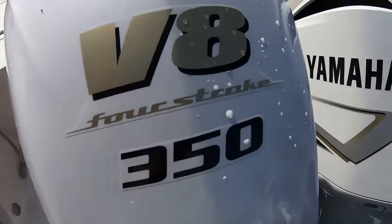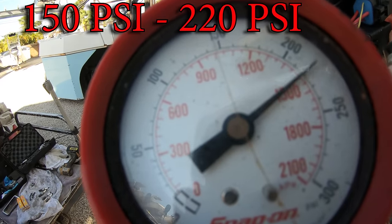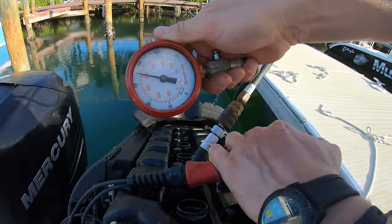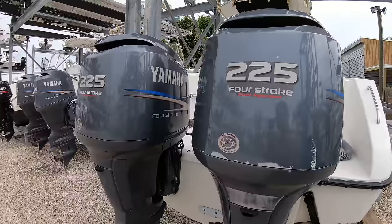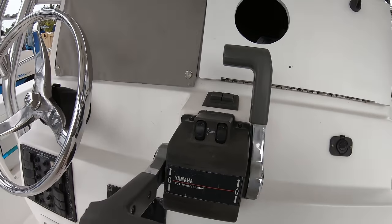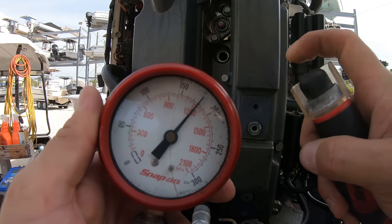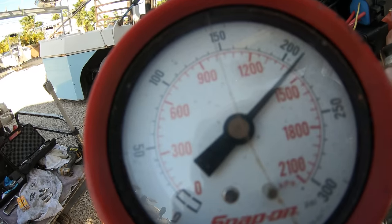With a four-stroke on the other hand, you will see a wider range of compression readings — anywhere from 150 psi to 220 psi, again depending on the age, hours, model, and brand. Normal readings for most engines are going to be between 180 and 200 psi. You will see 150 to 160 for a lot of engines though, but that is because of the throttle plates being closed. On a mechanically controlled engine, if you just put the handles in wide open throttle, you will generally see those numbers go up to 180 or so. Then some will have a much higher compression into the 200s.